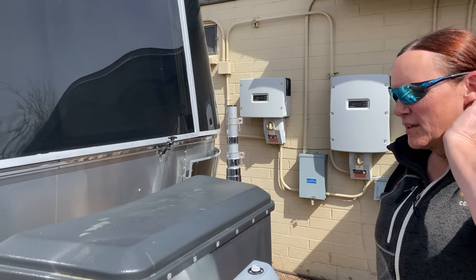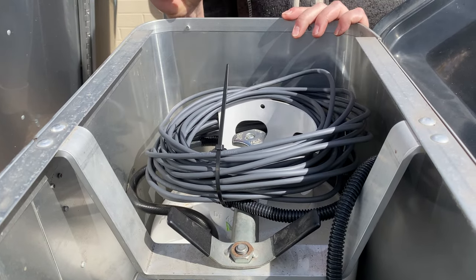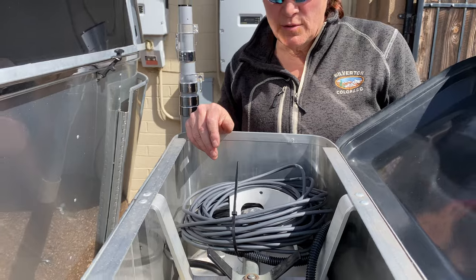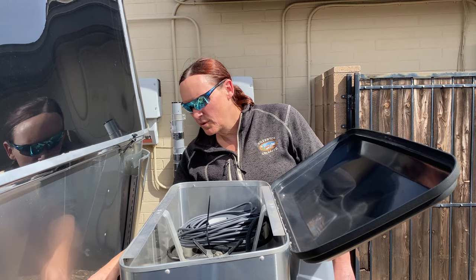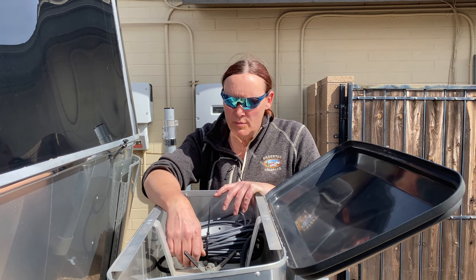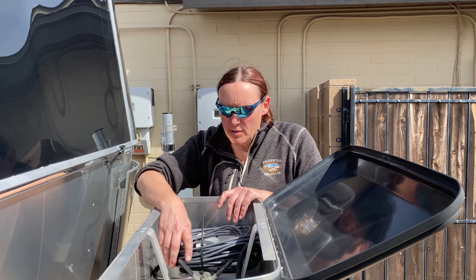Fred and I have finished running the wire — this is going to be my first cut, we'll see how it goes. I'm going to carry the excess right here on top of the tanks. These wires are not energized. This is the extra 75 feet of Dishy cable — Dishy's right here — so obviously I don't have to go far, but if I end up using the alternative mounts I may want to string this out somewhere. Fred and I ran this in the wire bundle harness all the way from the subfloor, along the frame rail, up into here. If I like it, it stays this way. If the wire interferes with propane cylinder changes, we'll come back in a future video to cut the cable and put in bulkhead connectors.